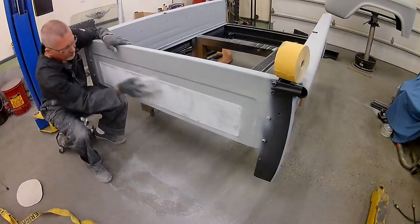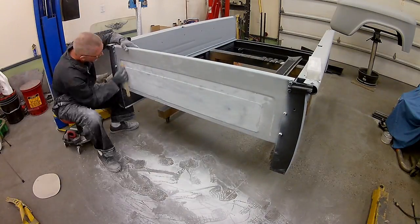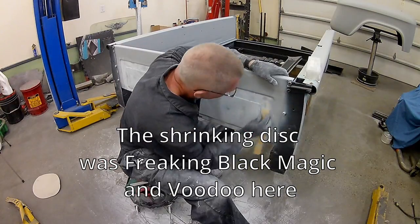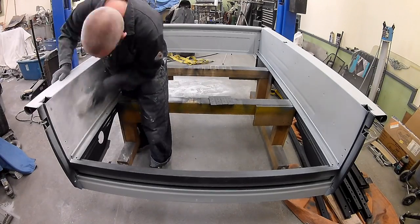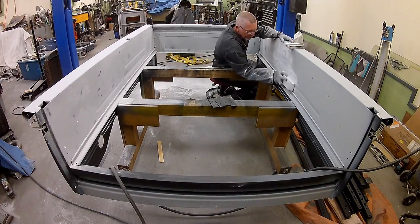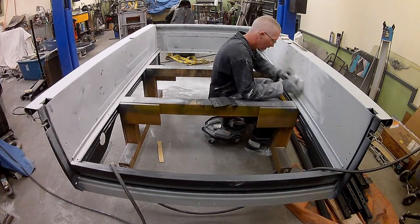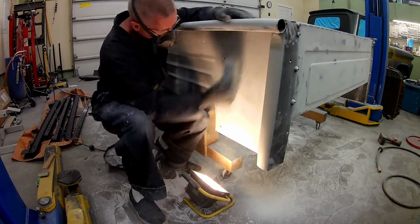One of the nice things about laying down a black primer is it is kind of its own guide coat to help you see what's going on. Notice the front of the bed here — this was the one that way back when I shortened the bed I hammered this thing all back into as straight as I could get it. And I actually got it really decently straight. The slick sand really helped make that thing nice too. This whole bed was just hammered — they were chucking everything, underhand, overhand, sideways. I think they put it under a rock fall. It was just mushroomed out and everything, and it's still not perfect. But the slick sand really helped smooth this thing out.